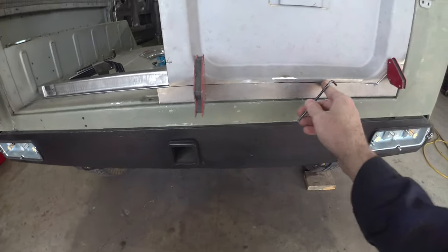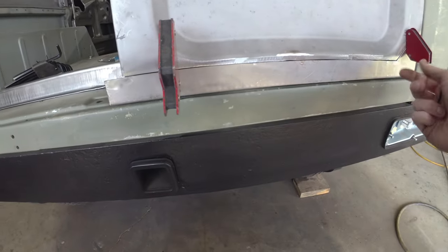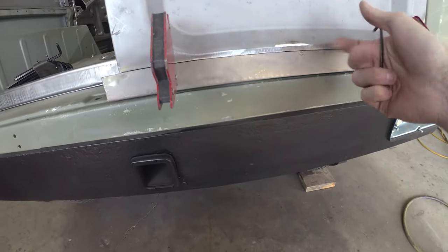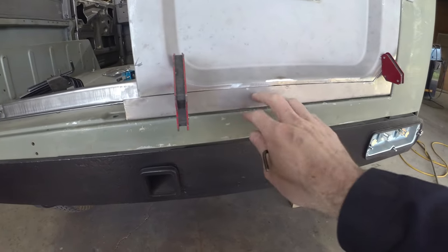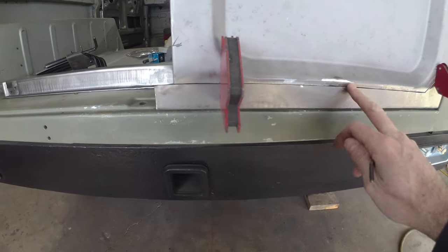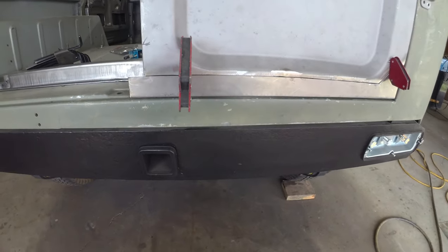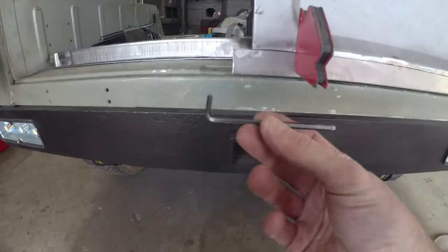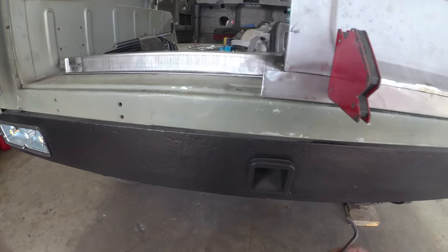So I got her tucked in there with the old welding magnets. Unfortunately, I can't use the panel clamps because of both the shape and the fact that it's an enclosed space. You could probably get away with some Clecos. I don't have those. I should order up a pair of those, or a set. Reminder for the evening.